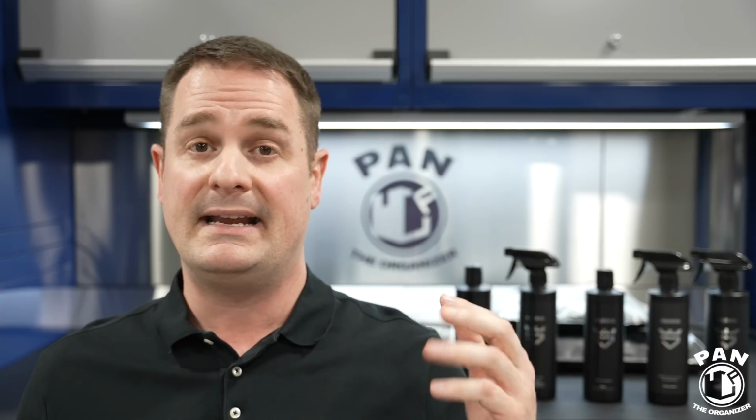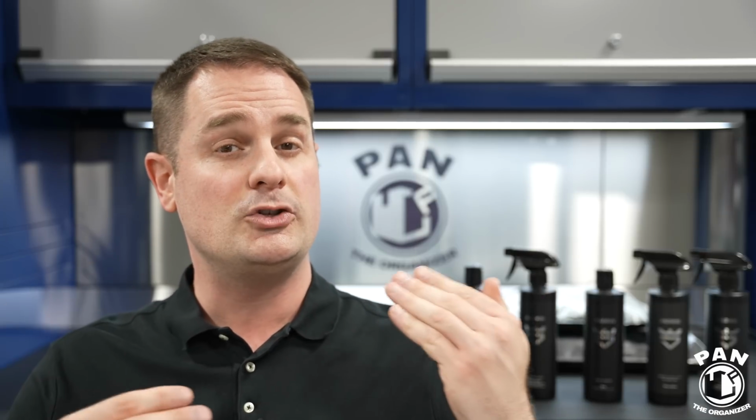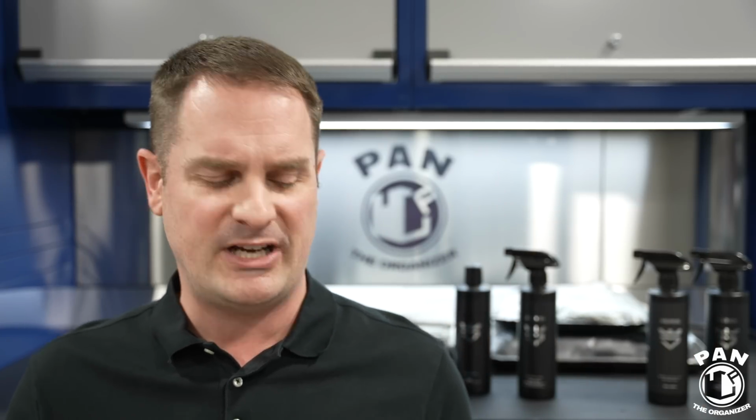And again, crucial, wait 7 to 14 days before you wash your car. That way the coating continues to cure during that time, and it's going to fully harden for its maximum protection and durability. And then maintenance is super simple. Again, I talked to you guys about maintenance with a wax-free, pH-neutral shampoo. And of course, AvalonKing has got you covered.